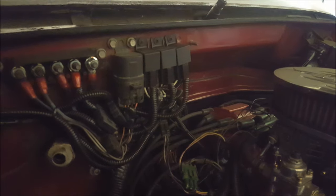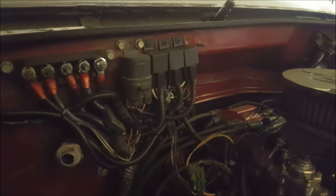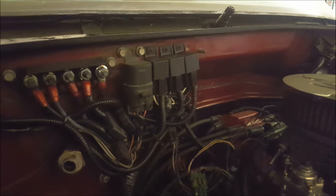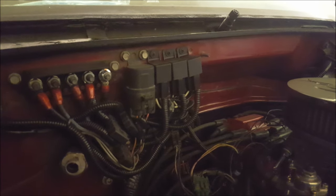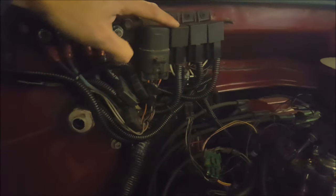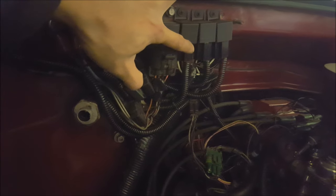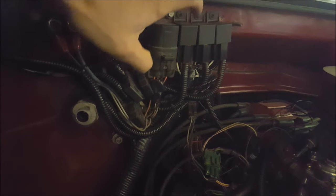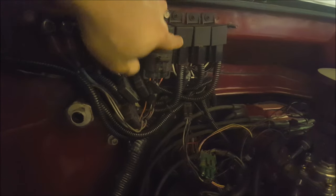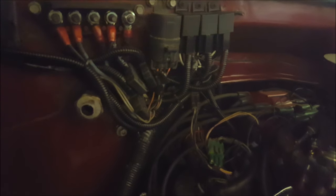That Holley under there does pull quite a bit of amperage compared to a regular pump. But even then I only have 10 amps on it, so it's not pulling huge current anyway. This relay is hooked up to constant power, then we ground pin 85, and pin 86 would be on the ignition source — so when I hit ignition on the key tumbler, it connects 87 to 30, and 30 goes all the way to the pump.